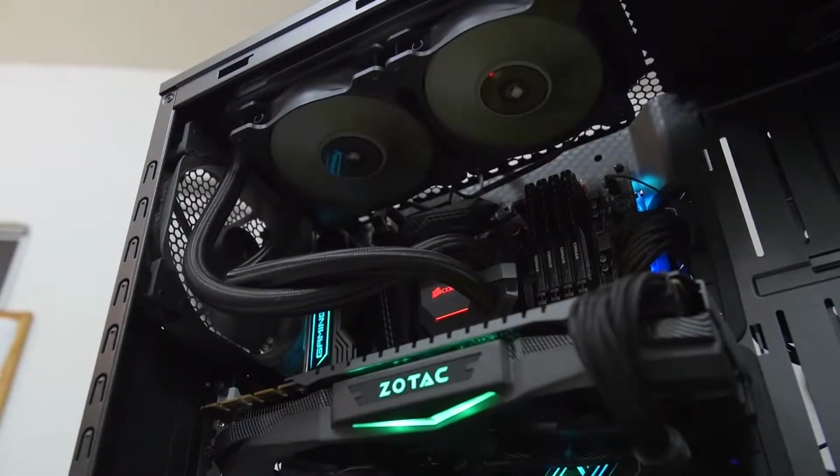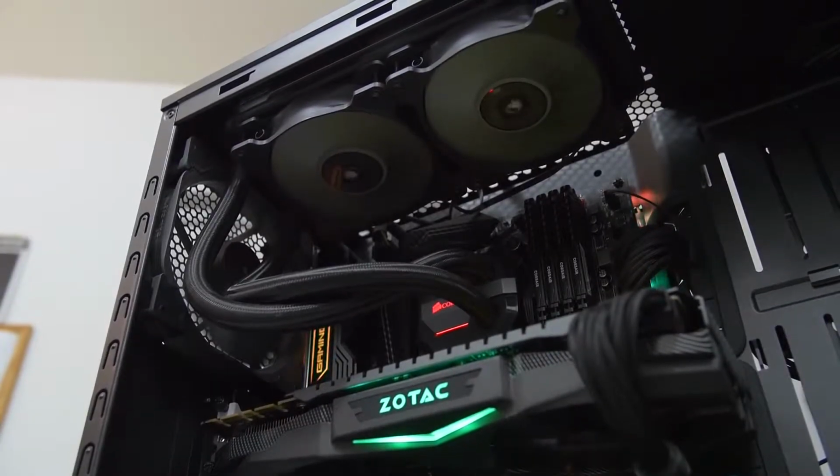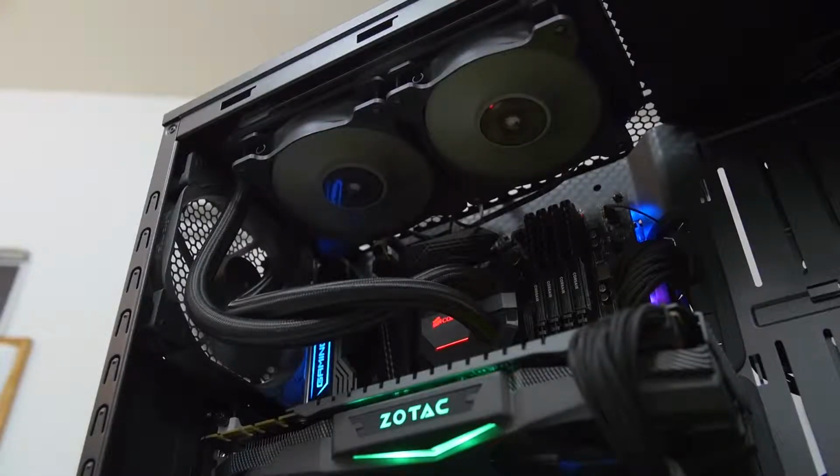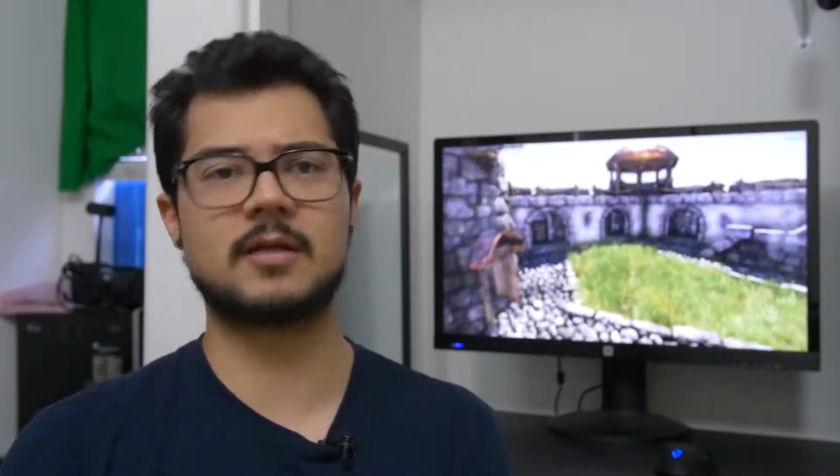However, you're also taking all that hot air and you're permeating your fin stack in that radiator with it. So that could potentially be hazardous for your CPU temps. When you actually have things like your GPU generating lots of heat under load and that warm air gets circulated inside your case and then passed through that fin array, that could potentially lead to higher CPU temperatures. We're going to find out whether or not it makes a difference today.